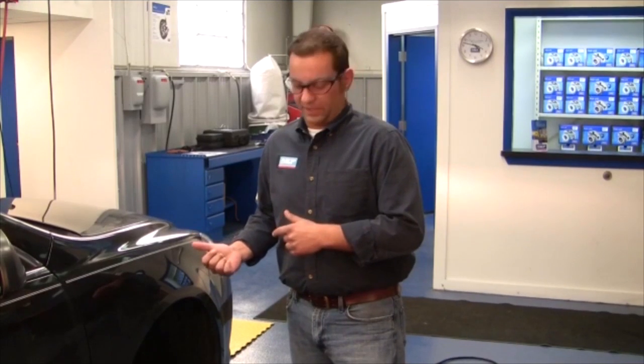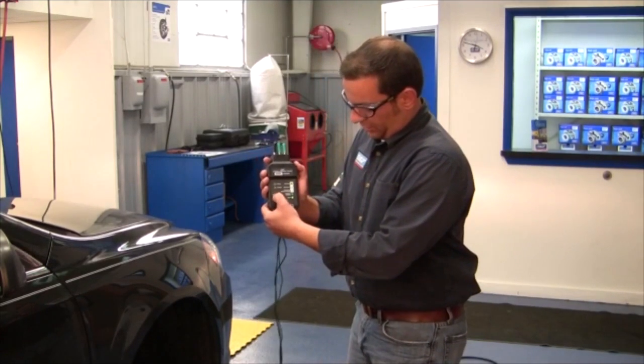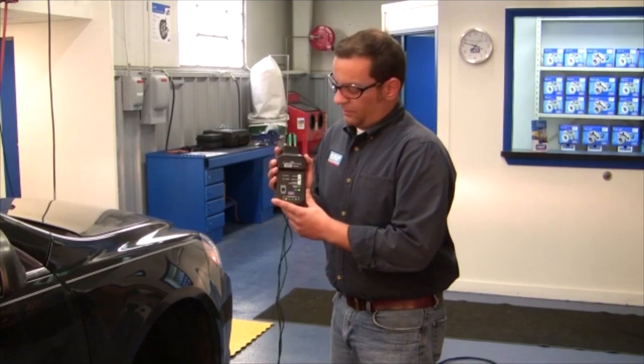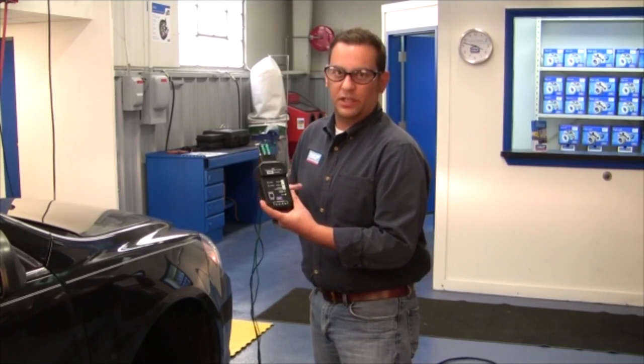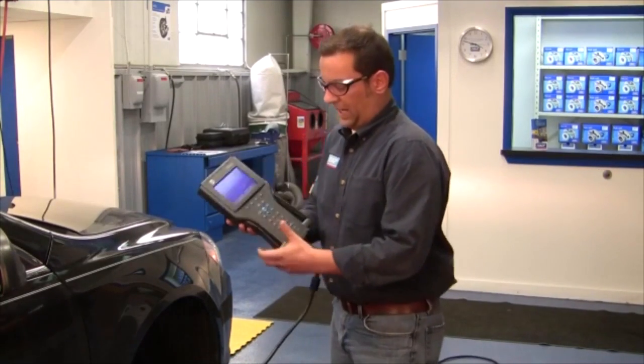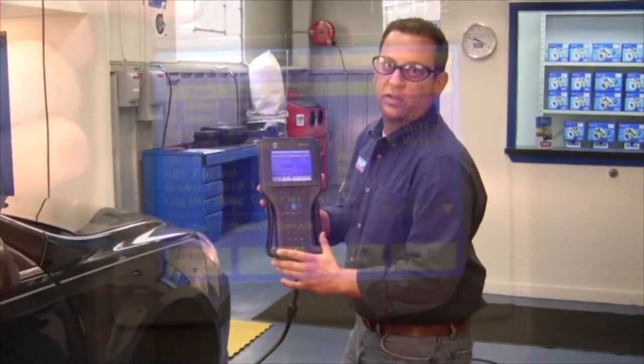After further diagnostics, we found and repaired a break on the ABS sensor harness on the vehicle side. Now we are going to recheck the system by hooking up again our ABS sensor pin point tester, turning it on, going to the simulator mode, and going to our active setting. By turning the simulator on, it is sending the wheel speed sensor signal up to the EBTCM. Now we take our scan tool and monitor the right front wheel speed sensor speed.